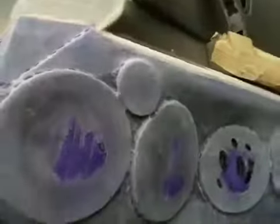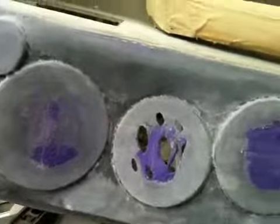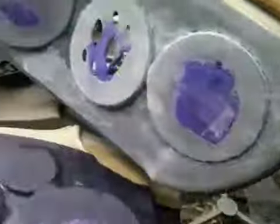Also, when I did resin this, I resined it on the door, and I put screws, okay? There was a screw there, there was a screw there, screw on the bottom, screws everywhere, all right? So that by the time it's completely hardened, it hardened while maintaining the exact shape of the door. When this door panel goes on and it's done, it's not going to have gaps, it's not going to be popping out, it's not going to be flimsy, none of that.